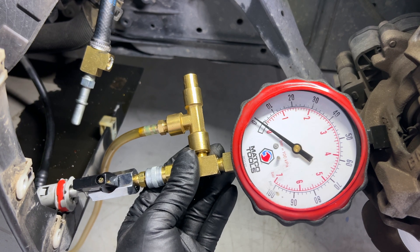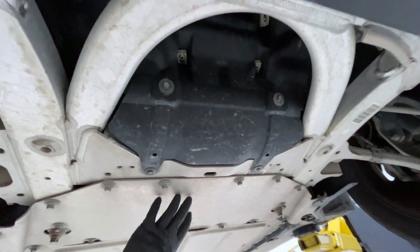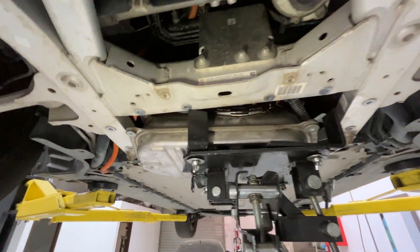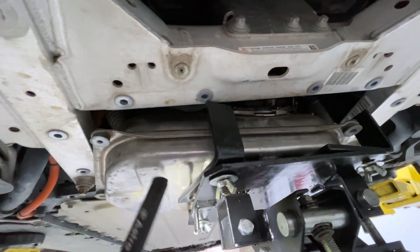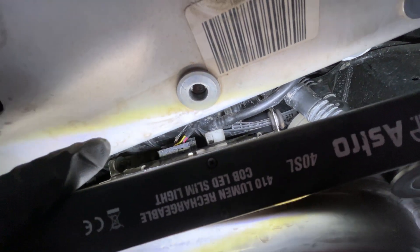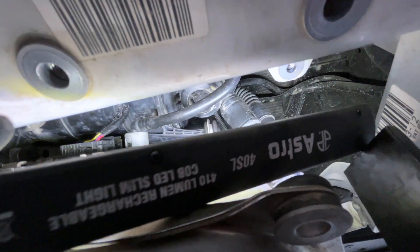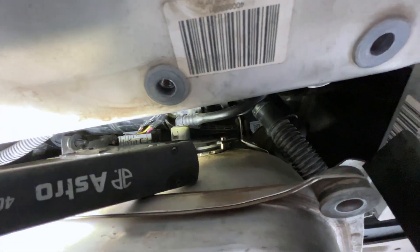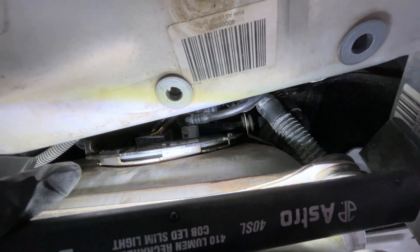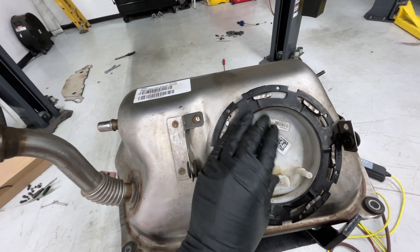The pump isn't sitting in the tank properly, or there's a pinched line, or a connection is swapped somewhere. We're going to go underneath the vehicle and check out the fuel pump and tank area — it's under a panel here. I've accessed the fuel tank — it's full of fuel, pretty heavy. Got the trans jack on it, and I don't see anything obvious externally. The feed line coming out looks okay, nothing's pinched. So I'm going to drop the tank down and open it up — this is a brand new pump, so maybe it was installed incorrectly, became jarred, or it's a faulty new pump.